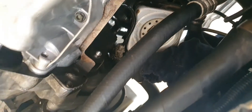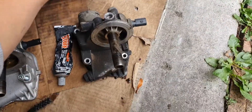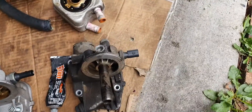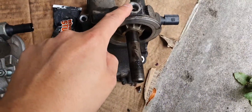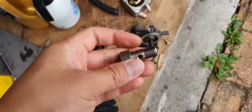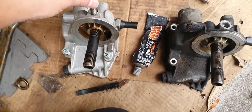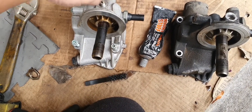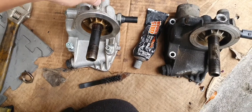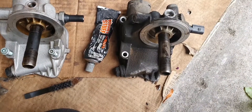Right, so to get that off it's just there. I did get it off, so I'll explain what I did. The other reason why I'm getting it off is because I stripped this piece — my banjo bolt I couldn't get on because of the aircon hose. It's supposed to go on like that but I had rounded that out.